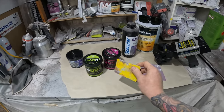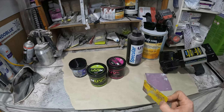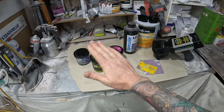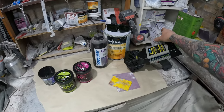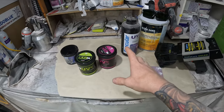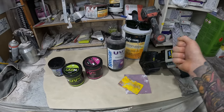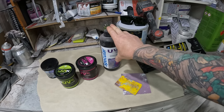I recommend getting the filler in nice and tight — don't over-apply. Two skims are rarely necessary; it just stands out really nicely. It's very hard, so if you're used to blocking small filler repairs with 180 grit, go to 120 or even 80 — it might sound extreme but 180 just won't work. Get the basic shape with 80 then go down through the grades. You're left with a pinhole-free finish; just a quick bit of 1K primer on top and you're good to go.